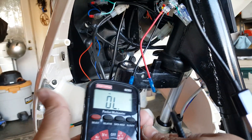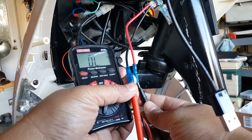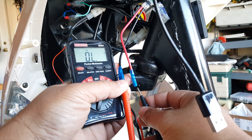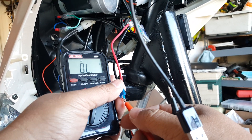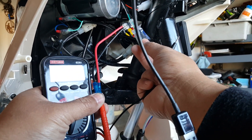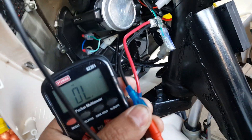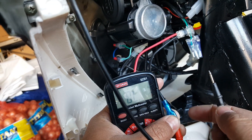These two wires should not beep because there should be no connection between these two lines if we did it correctly. Let's put one probe in here — it doesn't matter which polarity, we're just testing for continuity, so you don't have to match black with black. It has some resistance in the wire, but I'm not hearing it beep, so that's a good thing. We're going to leave the black probe in here, and then we're going to go up and test the black — actually, the black wire on our harness is indicating ground. So we're going to test it on the green wire: get our black wire here, move the red wire out of the way, and go for the black wire to test the green. It should have continuity.